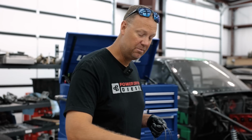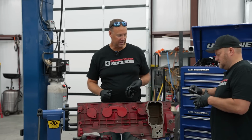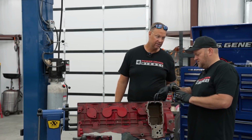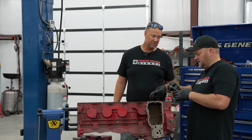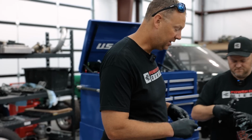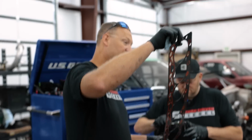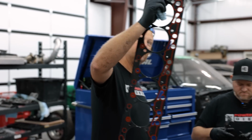This is a 4.250 bore engine for those who care. So 105 thousandths is what they start at, and right now they are 93. 93, so 12 thousandths. 91. About 91. So 14 thousandths of crush on this ring is what we achieved, those 14 mil head studs. This thing's totally, you just take this somewhere, you could totally reuse that. That was totally in fine condition.